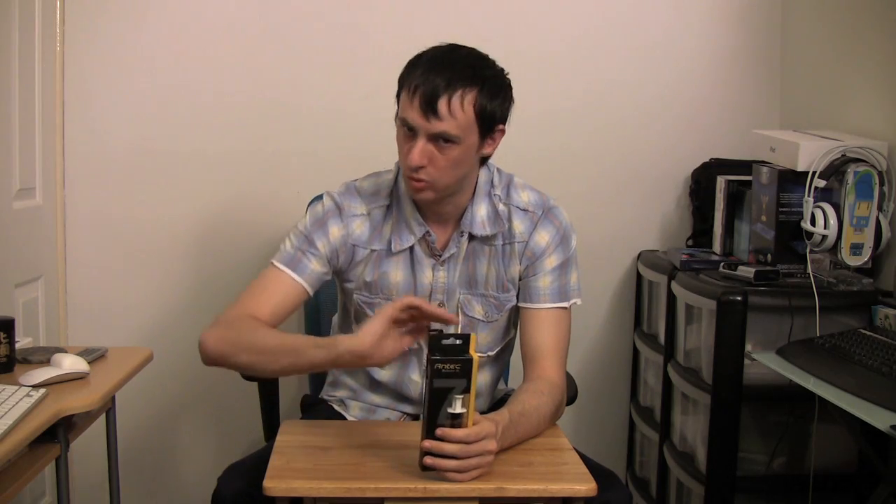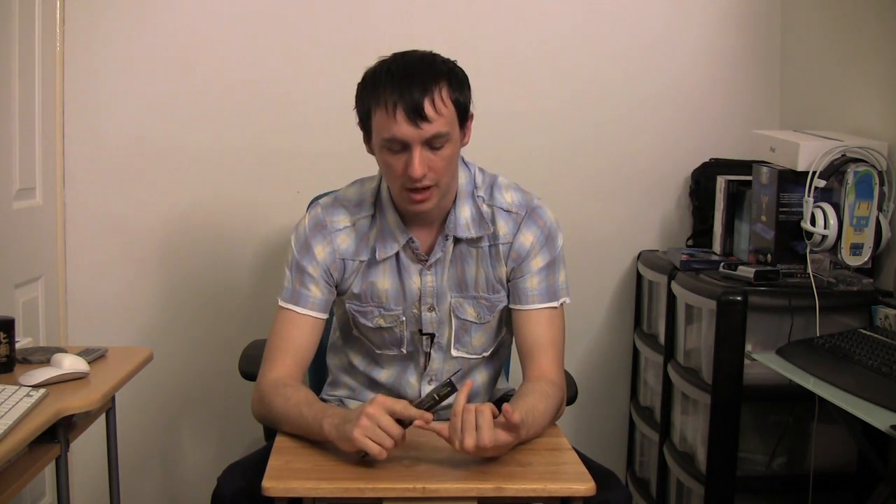This is definitely well recommended — the Antec Formula 7 Nano Diamond Compound. For those of you who have already fitted your system and already added some thermal compound, I definitely recommend wiping the existing compound off first. Just wipe it all off and make sure it's really, really clean — off the CPU and off the CPU cooler, your heat sink. Make sure it's fully clean.